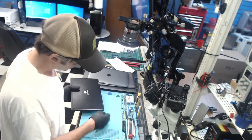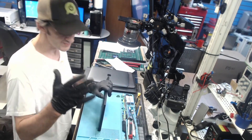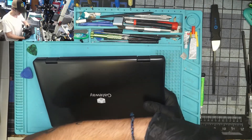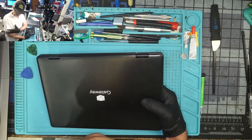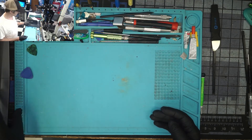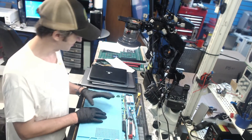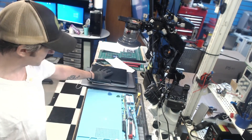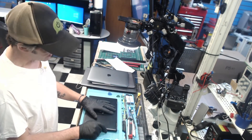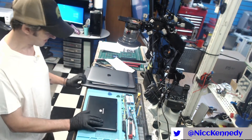Hopefully we can alleviate the warm spot on the bottom by using actual thermal paste instead of the silicon thermal pad - I don't even know what that would honestly do. The thermal paste should work better and this owner will be happy to get their device back. But really, who knows how long it's going to be useful - is it destined to join the stack of 'usable for a short time' devices, or the 'gets the job done for many years' stack? There's very little you can do to upgrade these - keep that in mind with smaller form factor devices, especially the convertibles.